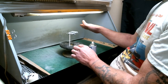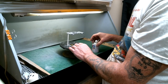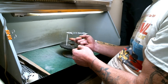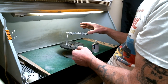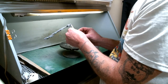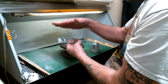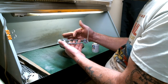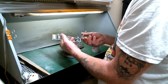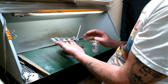Then we'll go ahead and spray everything else — the sides, the bottom. The main thing you really want to get well is the top of the frame rails, the top of the suspension, and this section down through here. The underneath of it — because if I flip this over, you're not going to see any of this when the body goes on. You won't see the top of the frame rails, the battery, any of that. So if you don't get a whole lot of paint in there, that's fine, but just get the main areas and try to get everything even throughout.